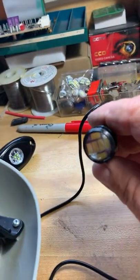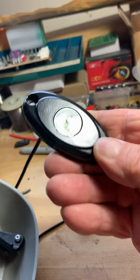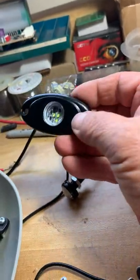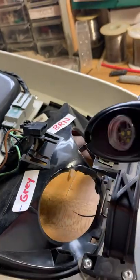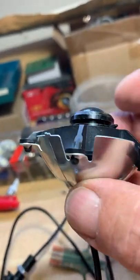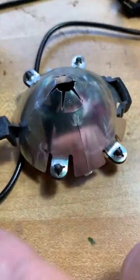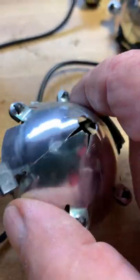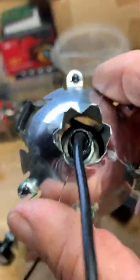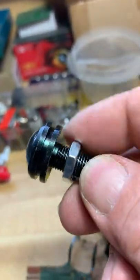I thought if I can mount these in that same space at the same angle, it'd probably be much better than what I had. I also looked at some other things like these rock lights - these things are pretty bright, but the dimensions of them just didn't seem to fit. I didn't want to cobble this all up trying to drill holes and all that crazy stuff, so I went with the cat eyes. What I ended up doing is taking that housing and opening up the back side - these fins were closed up, that was just how they came. I opened it up so that I could have access to it, and I dropped the cat eye light through there.